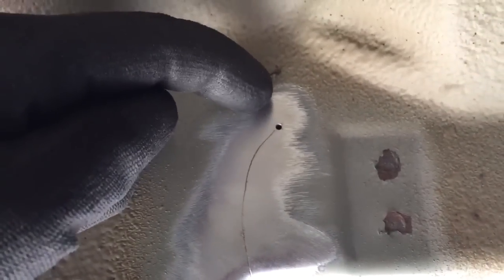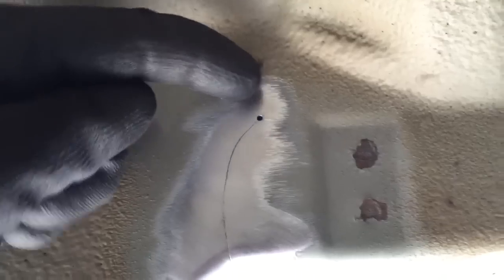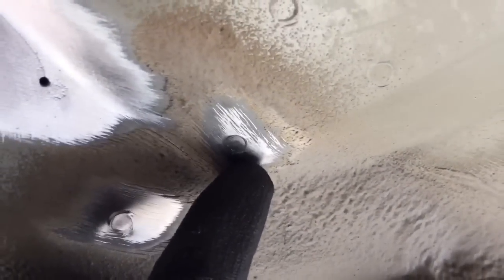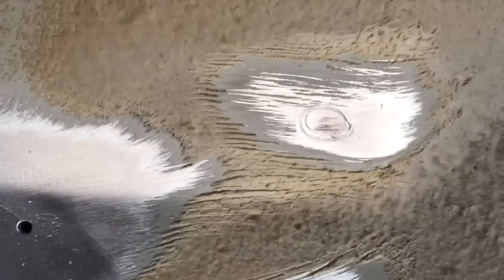And then on the left rear mount, that one needs to stop drill one more time. As you see, once I've taken the sealer off, you can see that the crack was further past than where I initially thought. So I'll stop drill that one again, further on. Nice crack there. And there's definite starting of a crack around this spot weld, and possibly some early movement around that one. So we'll just get these welded up now.